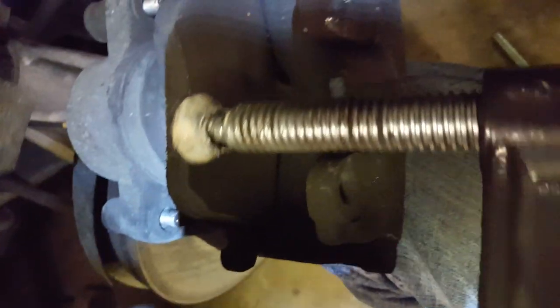What I do is leave this piece in — everybody's got their own way of compressing it. I just use a C-clamp. I put the C-clamp on there and push that piston back into place, then I'll resume right after that.